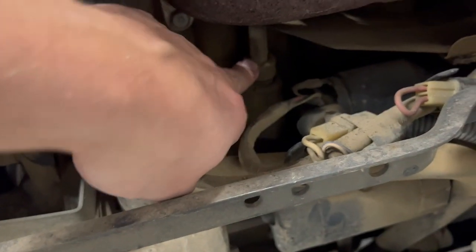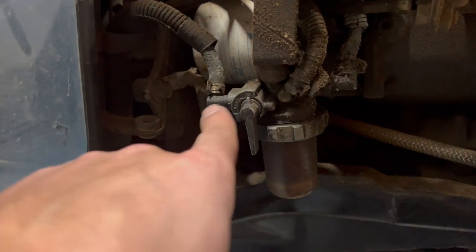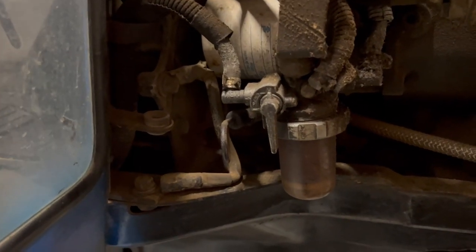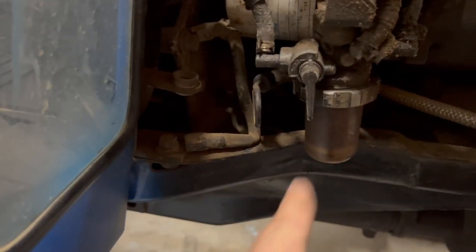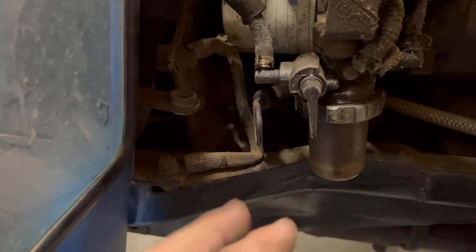Over here is the RPM cable — it goes from here to the dashboard. Of course, if you want to change the fuel filter, as many times before, you will put this one to zero, you will change this filter. And this time, because you have an extra fuel pump in the back, it will pump the diesel in. So you push the key to one and it will push the diesel into the glass, and the air is out of the system. That works perfectly.